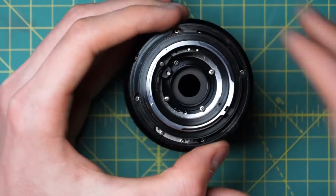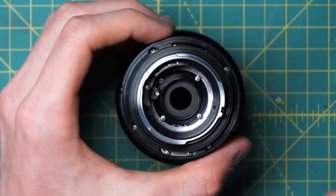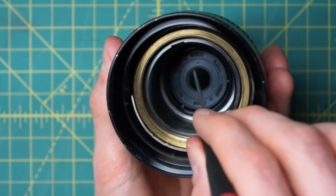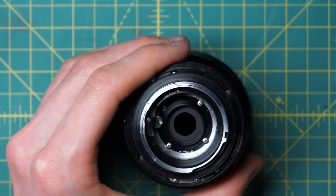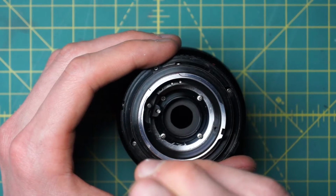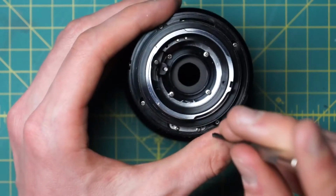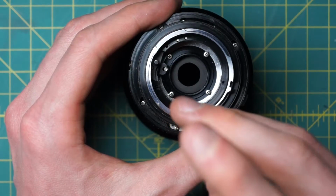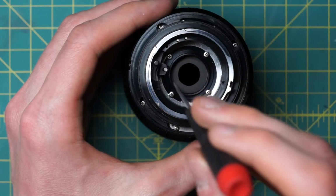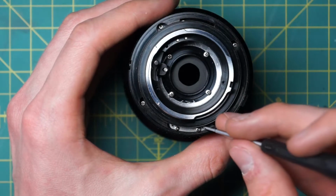When it's fully open though, there's still a bit of a problem. It's not actually entirely invisible. There are just the little edges of the aperture and the diaphragm going around there. So I need to adjust this other side a little bit as well. I'll loosen this up a tiny bit. This is just a trial and error process. If things are really, really off, then you need to go back to this intersection and actually spin the aperture and hold diaphragm piece around.